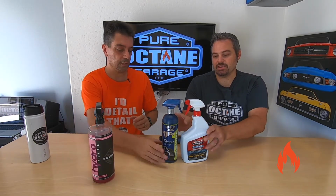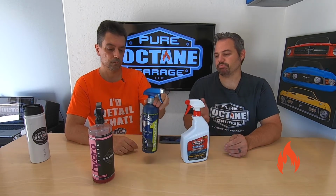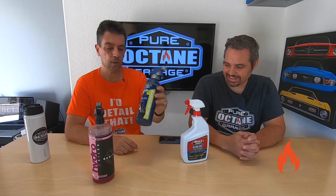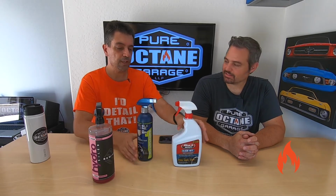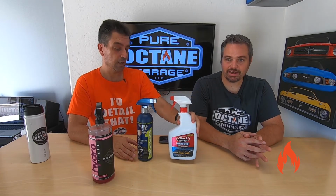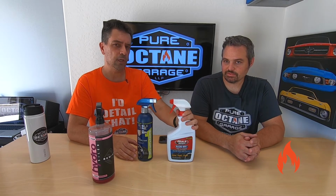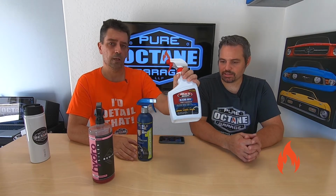This is good here, we'll set that aside. But here, iron remover. You can use iron remover on a vehicle if you want, but to remove product, you don't really need to. So we started with this for a while and used it a lot, and then most recently we switched over to the Blackmagic Bleche-Wite tire cleaner. It tends to remove product pretty quickly. We have yet to try this on a real heavy-duty ceramic coating. It's been more waxes and light sealants, and it strips it right off. One shot and done.